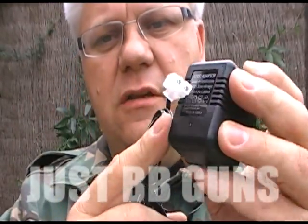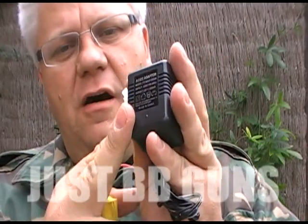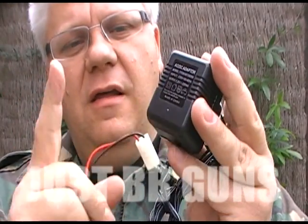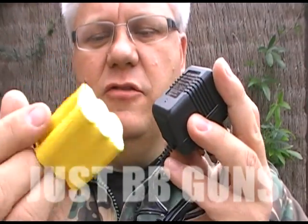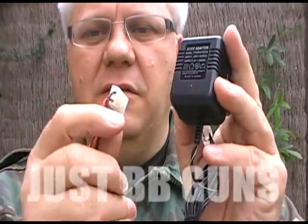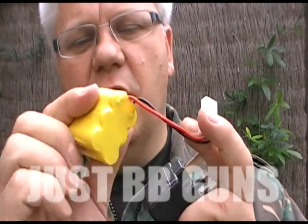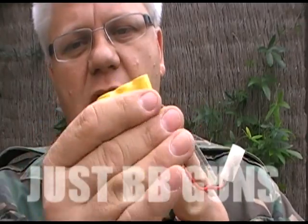We get a lot of questions about charging. Most important thing to remember: it will take about an hour to an hour and a half if it's completely flat — you should never let the battery go completely flat. Don't put it on overnight; do not fry the battery or you'll kill it. Best thing is to charge it for about an hour. If the battery gets warm to hot, switch it off — it's done. If it's cold, it still needs charging.